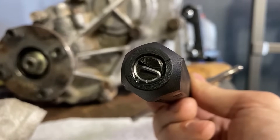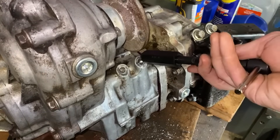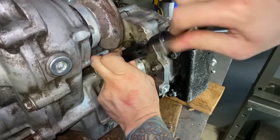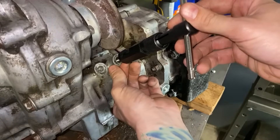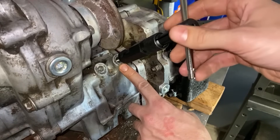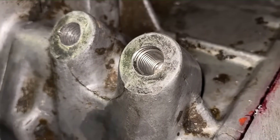We're using the tap wrench to drive the threaded insert through the pre-coil tool. Now take the tool, line it up to the hole, and start installing the insert. This part can be really frustrating to line up but eventually you'll get it and it'll go in with ease. You can see how far it's gone in by looking at the side of your tool. The coil is installed — we can see it has threaded out of the pre-coil tool and into our newly tapped threads. Now unthread the installation tool from the coil and we can see that our helicoil has successfully been installed.